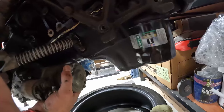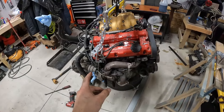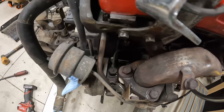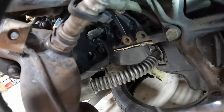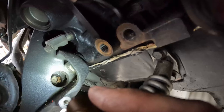If it's not separating for you, it's probably because you missed a bolt, because this should slip apart pretty easily. I've been here for like the last 20 minutes trying to get this transmission separated - and I'm the same one that told you if it's not separating it's probably because you have a bolt holding it. This one is a really weird one and it took me a minute to find it. One of the front mounts - it's a lot more difficult on these VR4s because the turbo manifold goes over it, but way down in there there's a 17 millimeter bolt accessible only from the back side through a little access hole.